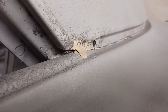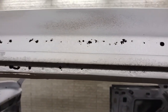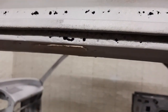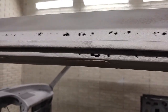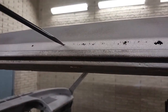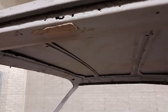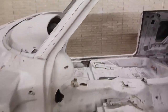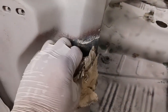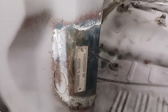They used to use brass a lot, but brass will always crack on a stress joint. The media blasting revealed some more rusted-out areas. A lot of times people ask for an upfront estimate on a restoration, but you really can't give an accurate estimate until the vehicle's been media blasted — most of this rust was not even visible when I first looked at the car.